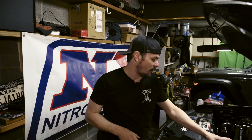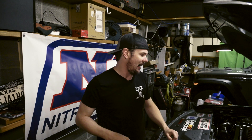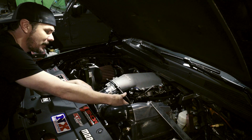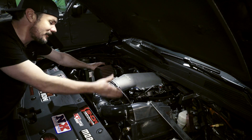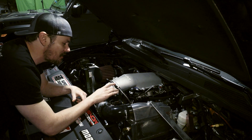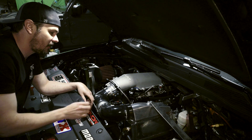Getting back to the mass airflow sensor — we have an issue where it will not tune. Our mass airflow sensor is really close to the throttle body, and we're running a healthy cam, so it's just not ideal. We do have a barometric breakout, which you're required to run whenever you're running some kind of boost with the sensor after the boost, so that the pressure ratio — specifically on Gen 5s — can be used to calculate barometric pressure. That's not an issue so much on Gen 4 and definitely not on Gen 3.